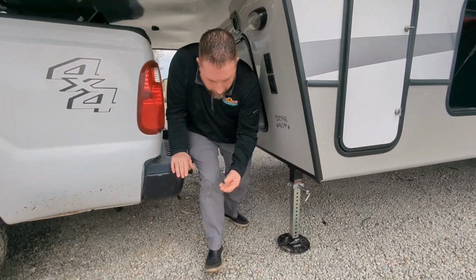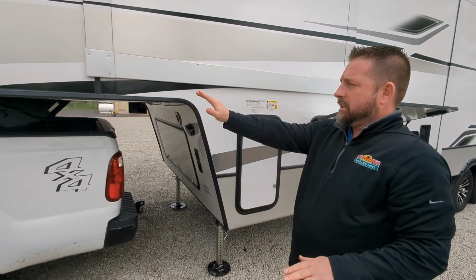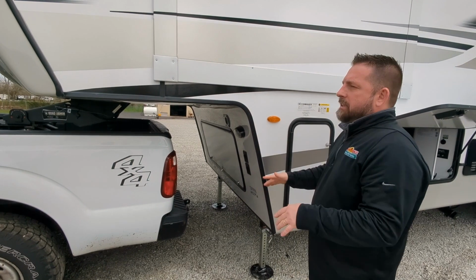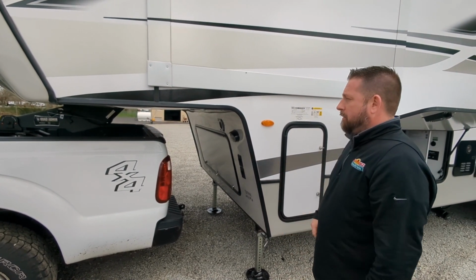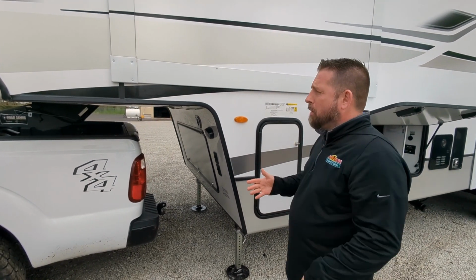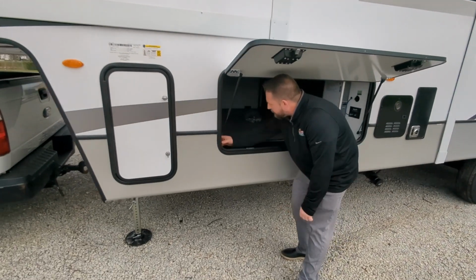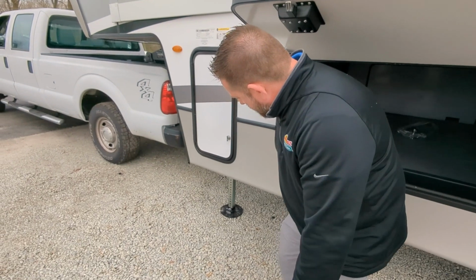Okay, now you don't want to go ahead and unlock the hitch just yet with the legs just down from there. It would be enough to catch it that it probably wouldn't hit on here, but just in case, maybe you didn't get your truck all the way in park, or you forgot to do something, or maybe you're on enough of a slope and the wheel isn't chocked yet that this thing could roll. You don't want to take a chance of the kingpin hitting the tailgate or this hitting the top of the bed. So I always run these legs down, get pressure on it first. So this one, all we've got to do is hold this front button.